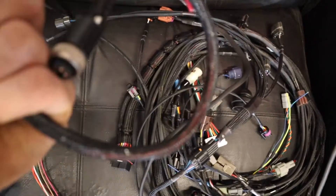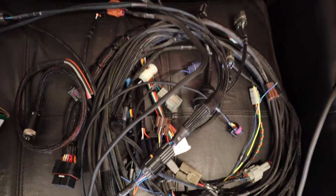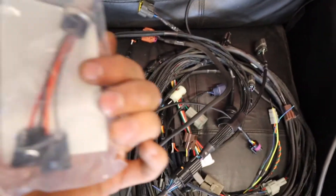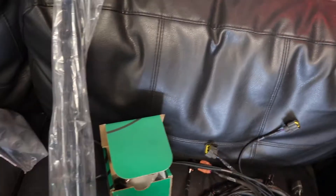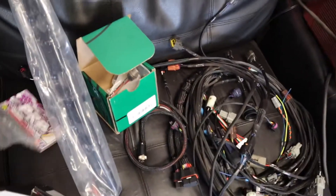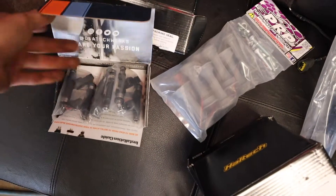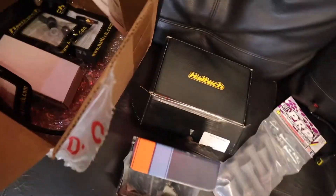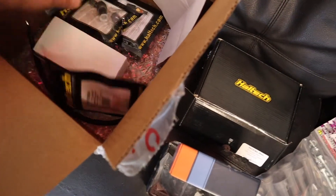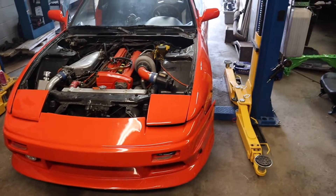The Radium connector side goes in, and this one seals on top of the tank — there are our fuel pump connections right there, which will clean up the wiring in the back. There's our R35 coil bracket — we're going to be putting the R35 coils on it with boots. We're upgrading the injectors because anytime you're doing anything to these engines you should upgrade the injectors and not just run the stock ones hoping for the best. We've got all our Haltech sensors for the computer.